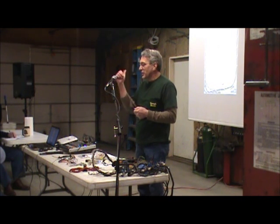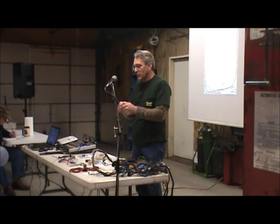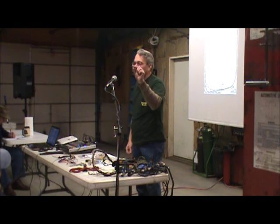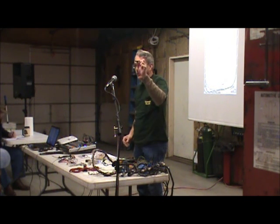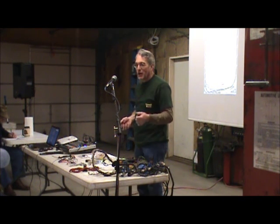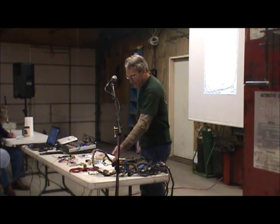But you turn your lights on, and one set's real dim, and another set's real bright, and then you realize, well, maybe I got a ground problem, and you pull the connector apart, and all the pieces fall out. Don't bother reusing these. If you've got an electrical problem, you're trying to trace something, you got a dirty connection, throw these away. Put in a new one. They aren't worth saving. The bullet end can be polished up with a little bit of Scotch-Brite, but frankly, doing anything with this is more trouble than it's worth.